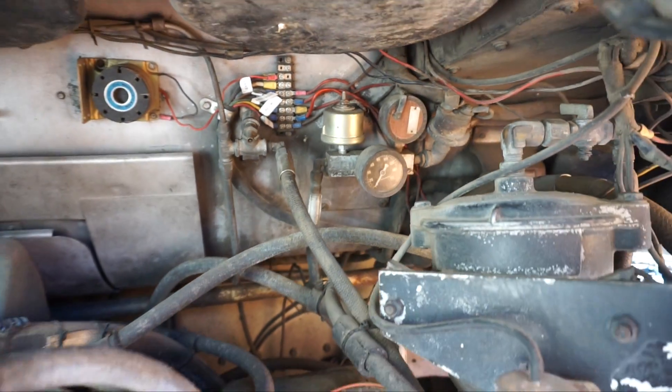Normally this wouldn't be a huge issue — you just put in the new sending unit, run the new wire, no big deal. The problem is this bus is 35 feet long, and to get back here and up through everything, you're talking probably over 45 feet of cable, and I think they sent 6 feet of cable. So it's not going to fit. I wanted to avoid running three wires. I traced this wire and it goes all the way to the front.